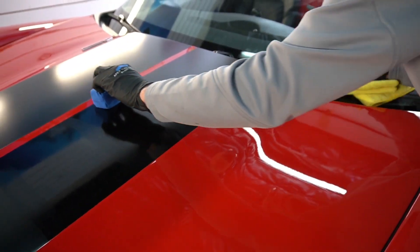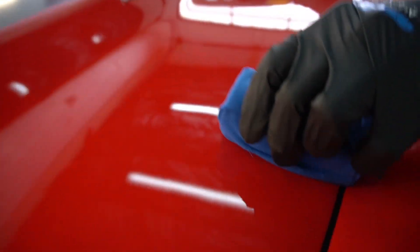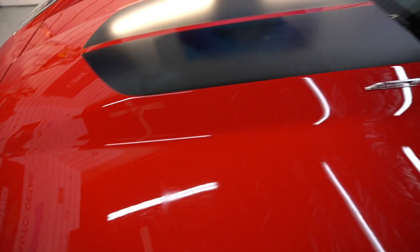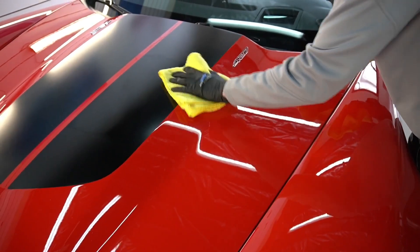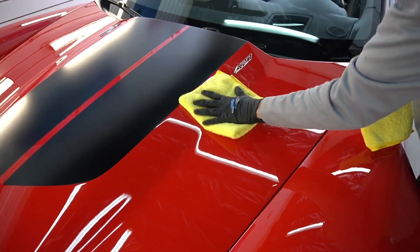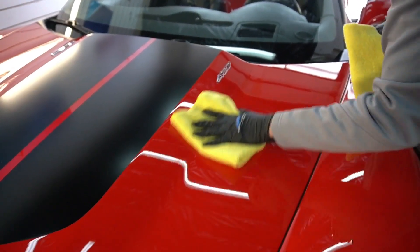Taking my time, not lifting the applicator, just slowly running it back and forth. I can get half of this hood applied within a minute to a minute and a half. As you can see, applied to a matte or satin finish — which it's perfectly safe for — you'll see it start to flash. Grab your first microfiber and gently go over the applied area, picking up some of the transfer solution and leveling the product, then the second microfiber comes in and buffs to perfection.